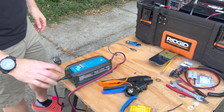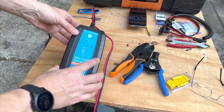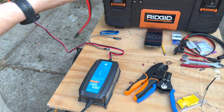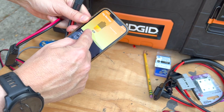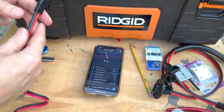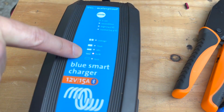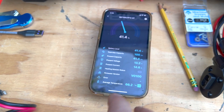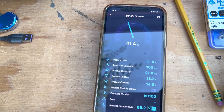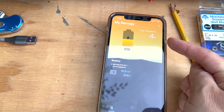Let's test this. First we're going to plug in our smart charger — it's set to lithium ion, that's good. Now we're going to hold our breath and plug it in. You can see its charge is at 41%. We're going to click on here and watch the amperage go up. It's plugged in and switched to bulk charging. There we go — jumped up to 14.6 amps coming into the battery.